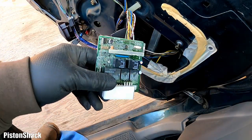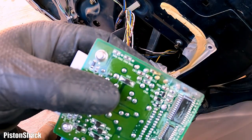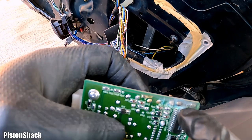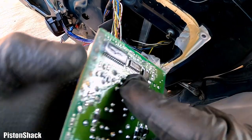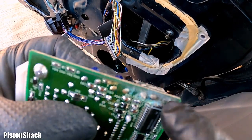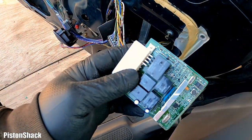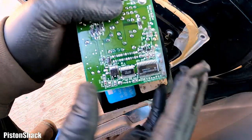Ooh. Looks rusty crusty. Look at that side. That's what's going on here. Lots of rust and crust. As you can see, this portion of this circuit board is corroded badly in greens, rusties, and yeah, this tiny little resistor here, it's almost rotten away, and there's a control chip. Yeah, it's all green, it's all corroded. Yeah, we need a new control module, that's for sure, or a working used one. And this is no go.